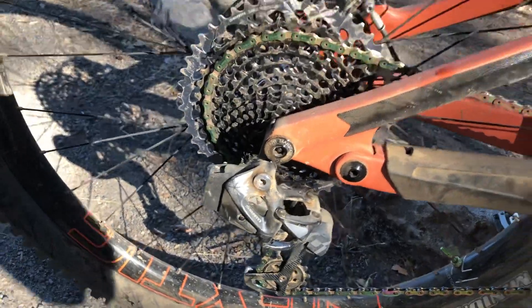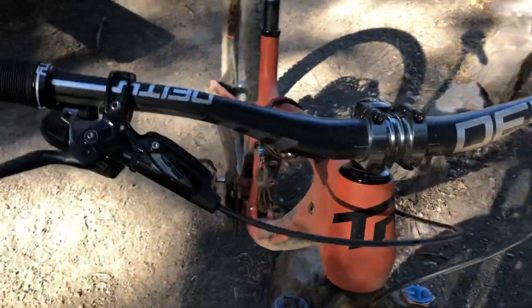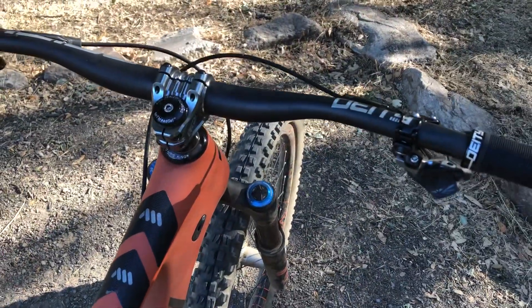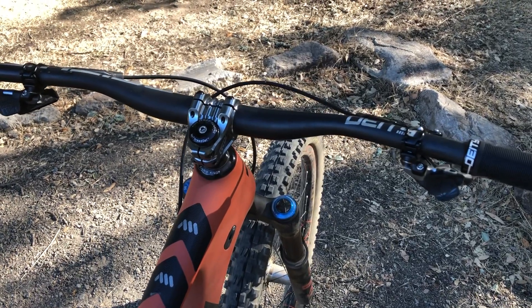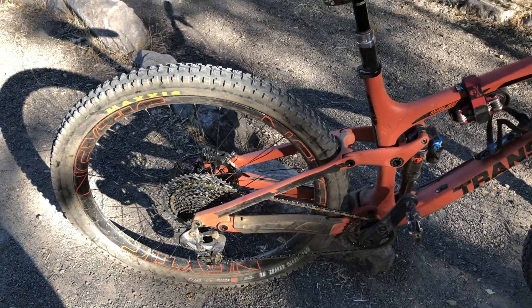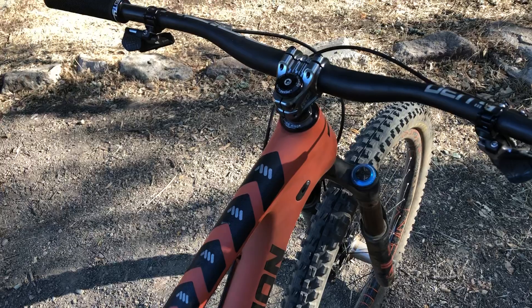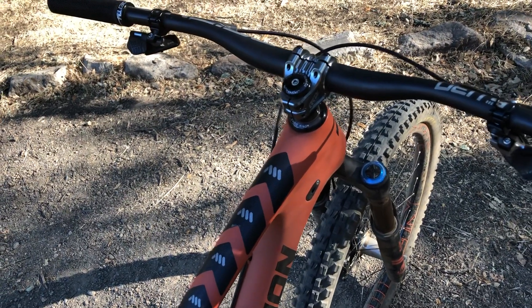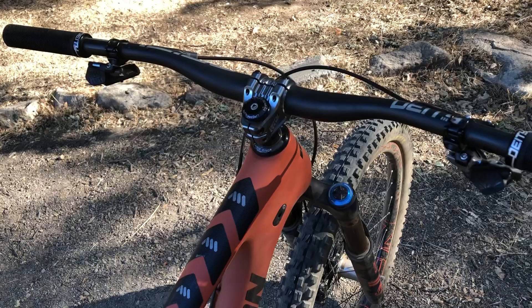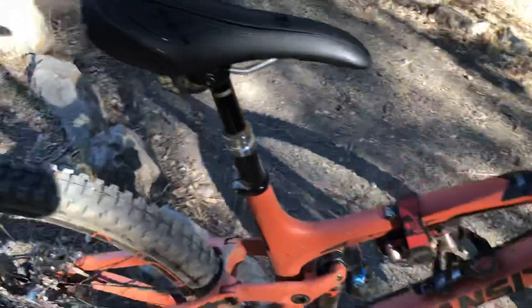I like how there's no cable clutter — it keeps the bike really clean and it is futuristic, it's a step in the right direction. But for me I would not spend my money on it. I would go for XTR 12-speed, XT 12-speed, pretty much anything Shimano. Compared to the cable-pull groupset, it feels different — it's a lighter actuation at the controller, but with normal XX1 when you feel a harsh shift you can modulate it with your thumb, whereas with an electronic shifter it just shifts for you and you can't tell it to shift slower or faster, so it just creates this hard clunk.